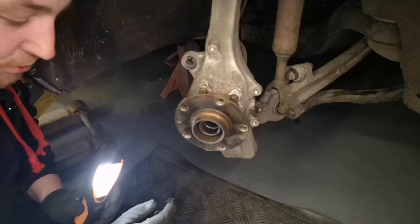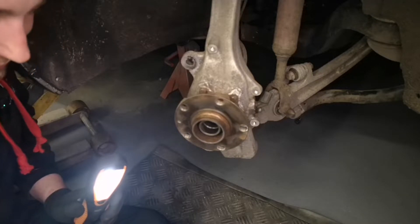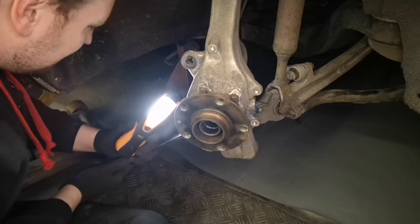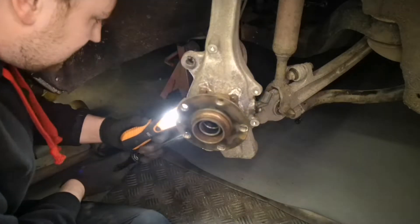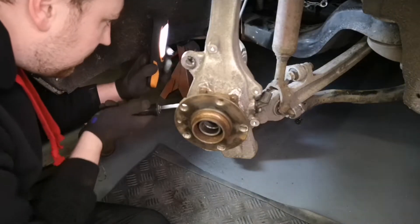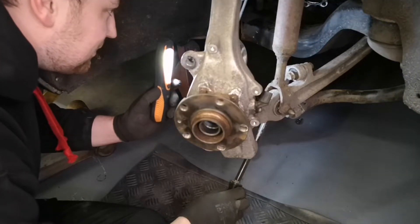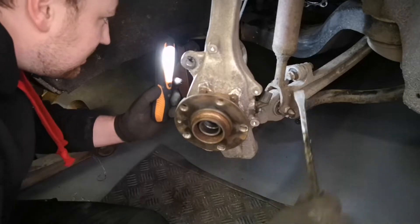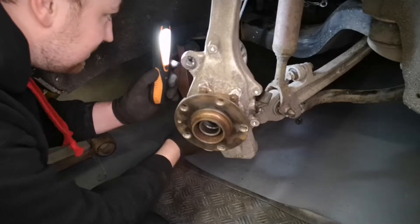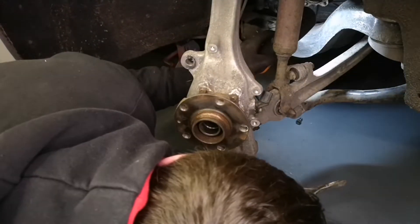It really does sound like a loose ball joint. I've had a lot of Novas over the years — high-powered Novas — and the bottom ball joints sometimes come loose because they bolt on, and it's kind of got that kind of noise and feel about it. I'm hoping to see some signs of rubbing somewhere. It's definitely a metal-on-metal noise — a quite loud distinctive clunk when it does it. Like I say, all these arms are new.